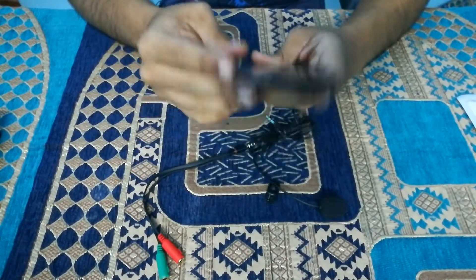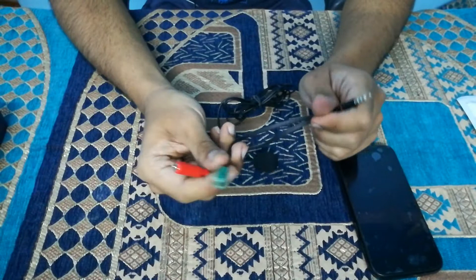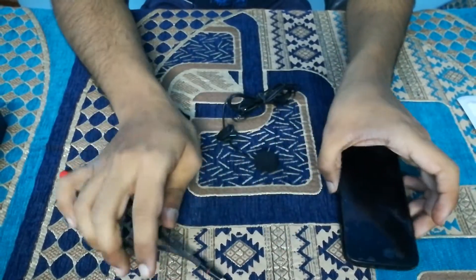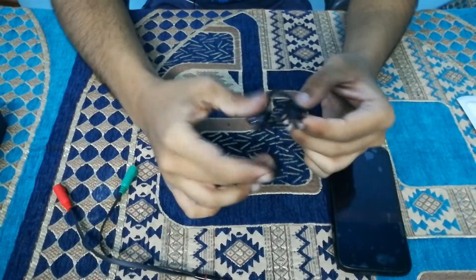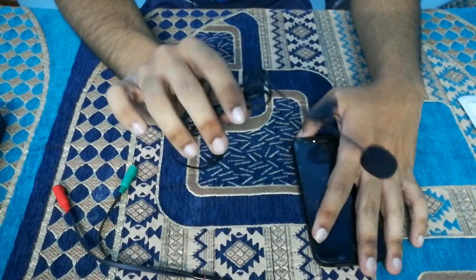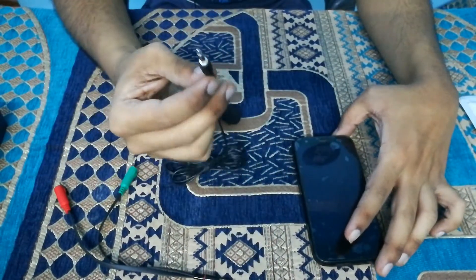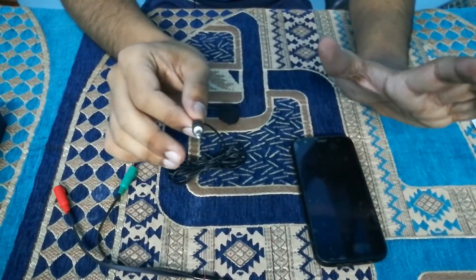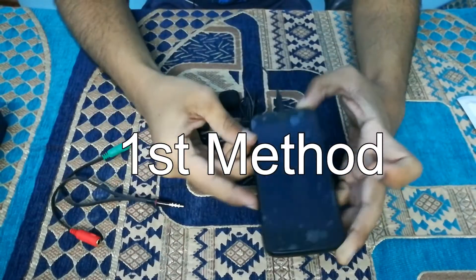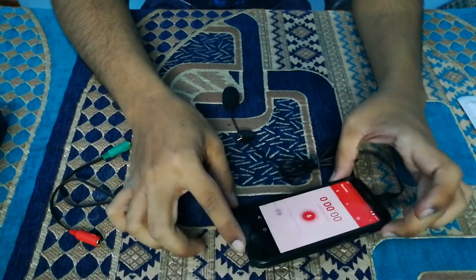In this video I'm just going to use this mobile to demonstrate. This microphone splitter cable has two jacks — one for the headphone and one for the microphone — but there are actually three configurations for it. First, how do you find out if this microphone is working for your device? I will connect it in three different ways. The first way, which I can guarantee will not work in 90% of cases, is to connect this microphone directly to the 3.5mm port.